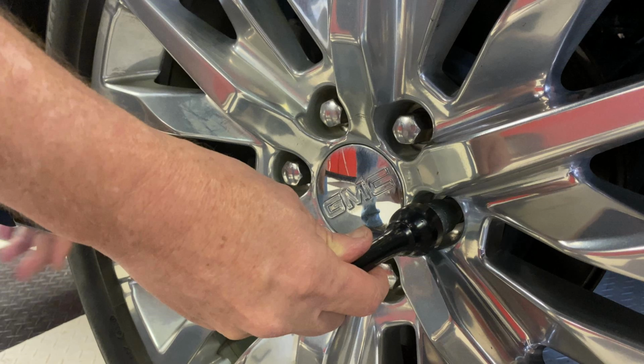Now, to get the jack out, the jack is only held in here with jack pressure, and it's a mechanical jack, so there's no hydraulics to it. So you're going to turn this counterclockwise until the jack loosens up enough to get off of these catch feet at the bottom, and then your jack is out, and it's going to be ready for operation. We'll pull this outside, and we'll show you how to get to the rest of the tools.